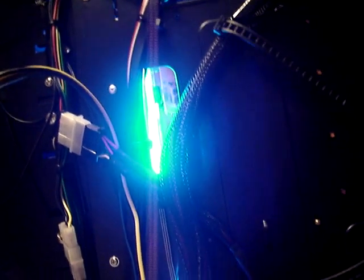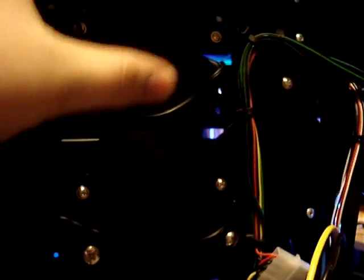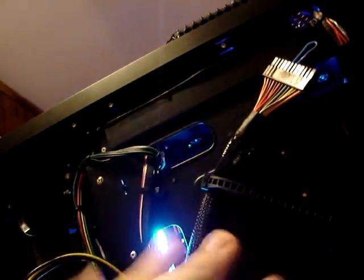And I'm going to show you one more thing — the wiring. I have to fix up some of the wiring. This is not how it's going to completely look because I don't know exactly where each wire is going to go on the motherboard yet. But that right there is for the UV light. Then I have my fan controller cables — those go to the side of the case, where it's more open so I can put thicker cables in. Then you have the 24-pin power cable for the motherboard — I have it coming to the side right now, which is taking up a lot of space, but that's just because I don't have the motherboard yet.